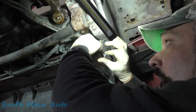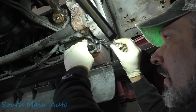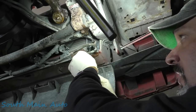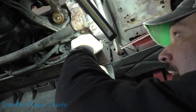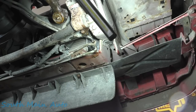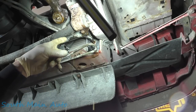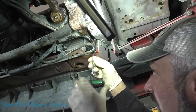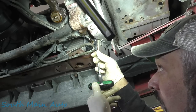perfect. Now we're going to use what they call a half inch wrench. Haven't used one of these in about 17 years. However, I still have one. So that's the transmission cooler line there. So we got that undone. We still need to get the radiator hose though. We're gonna use an 8mm on it. It's probably 5/16, but 8mm and 5/16 are super close.